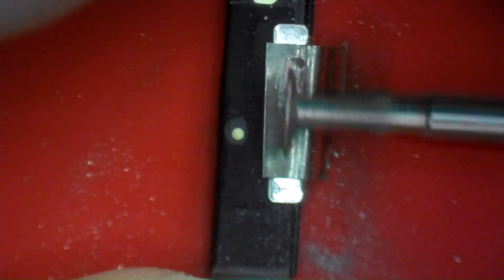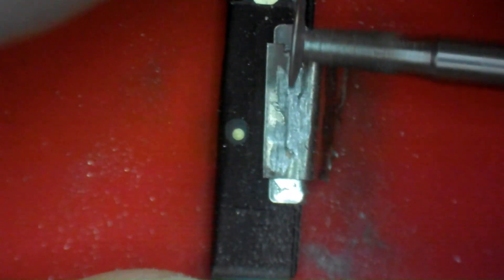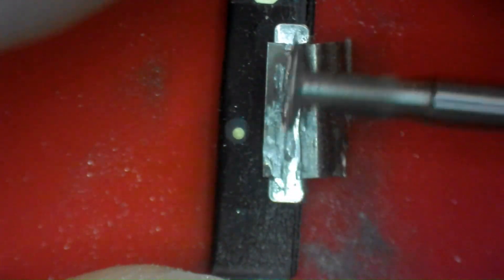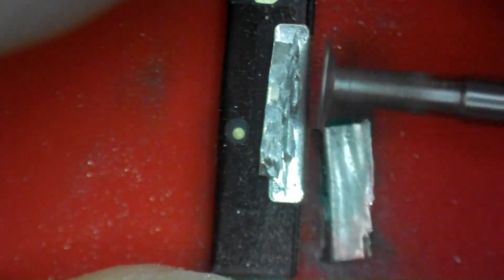To clean this off, I use the sharpening pin on basically level one — just the edge of the flathead bit — rubbing back and forth across these welds. A quick few passes will break down those welds and allow the residual lead to come off. On the 11 Pro and 11 Pro Max, the lead is laser-welded directly to the pad on the BMS with no tab folded over, so a few quick grinds back and forth will remove the residual lead and smooth the pad, prepping it for spot welding.